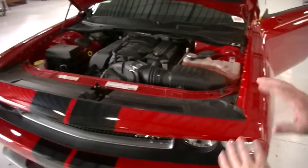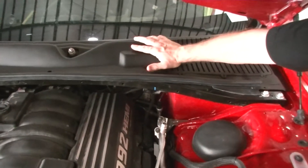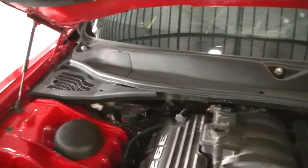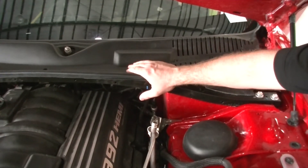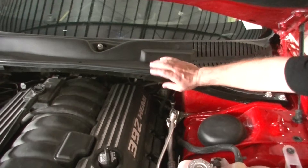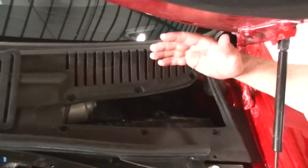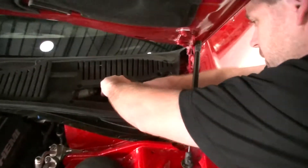If we just have a look under the bonnet — we've actually made a whole new wiper scuttle. A really challenging job to get this working exactly how it needs to. What we've done is we've taken the wiper mechanism and literally moved it to the right-hand side of the vehicle, so that we get exactly a perfect sweeping position as intended by the original manufacturer. We decided to make a whole new wiper scuttle because there were just too many modifications to the original to make it work. We've made an access point here which allows removal of the original pollen filter located for the air conditioning system.